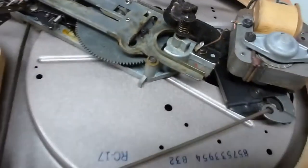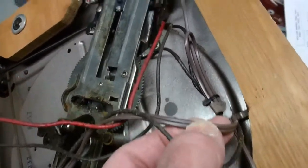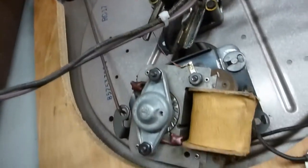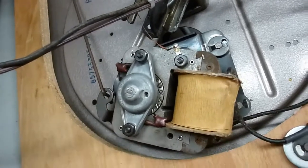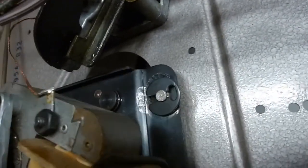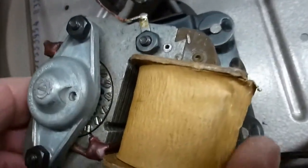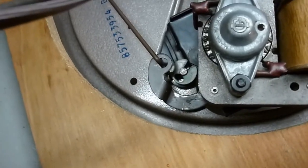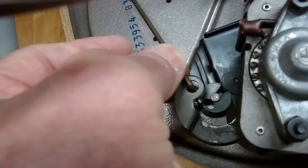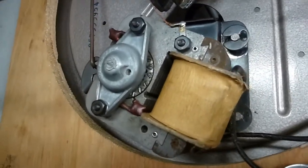A little bit of rewiring before you can even see if it works. I've got the wire fixed up that was routing AC down to the motor, so that is functioning again. I also pulled the motor apart and got it cleaned up and lubricated so it now turns. There are supposed to be some little rubber motor mounts that are completely missing. There's a Voice of Music website that has these old parts — I'll link it in the video. There's also a shift lever grommet that's missing, and the cartridge is bad, so I've ordered a new one.